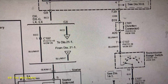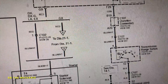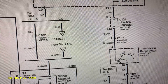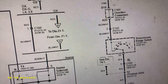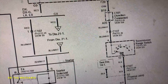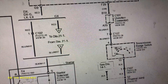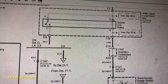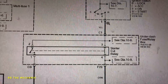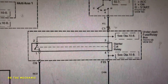Since we know that circuit is working, we're in good shape. Actually, I need to correct myself here — this circuit is the other way around. This is ground, not the ignition switch — this is actually the neutral switch. So you'll have a ground from Park and a ground from Neutral. Those are the two circuits that provide ground to the relay. It needs to be powered up from the key end, and when you turn the key to Start, the relay gets power and energizes. That's how simple it is.